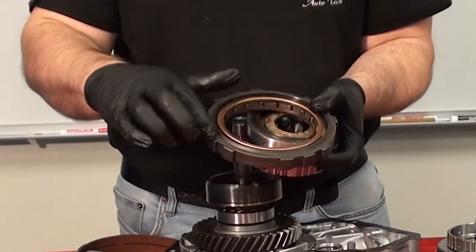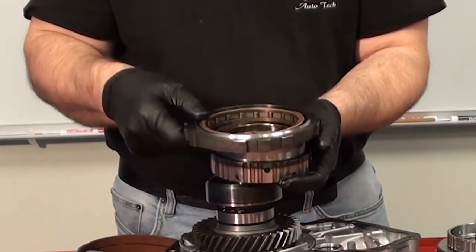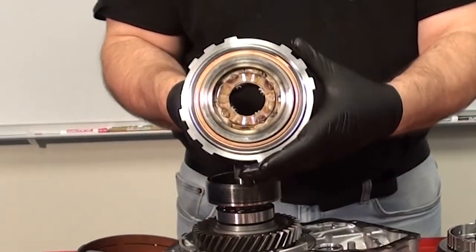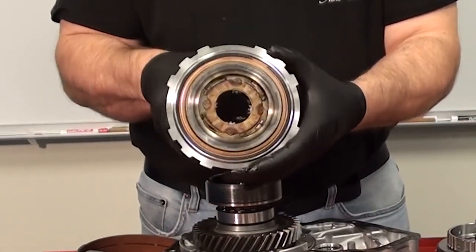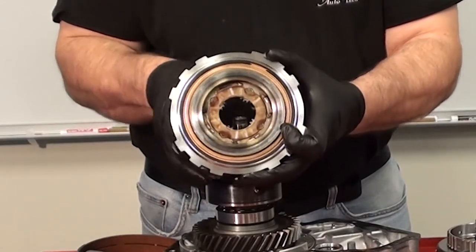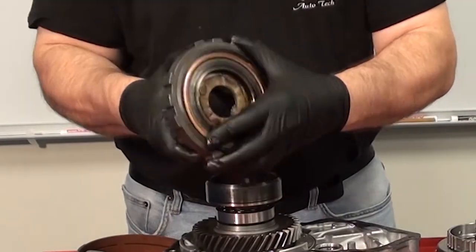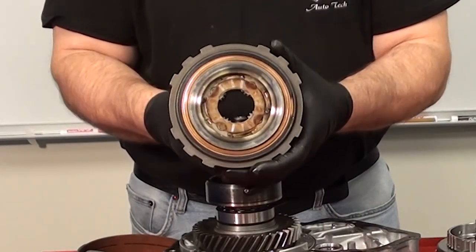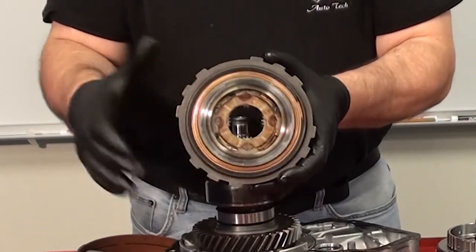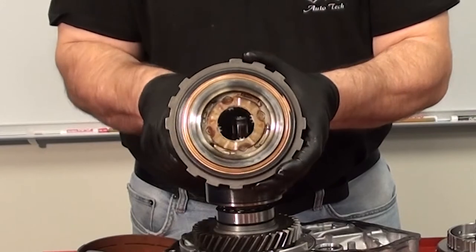The other side is dull, so this is directional and the shiny side goes up. When looking at the gear from the forward direction and I hold the outer part of the one-way clutch, the carrier gear will turn clockwise but it will not turn counter-clockwise. If for some reason the one-way clutch is installed backwards with the dull side up, the rear carrier will now turn counter-clockwise and not clockwise.